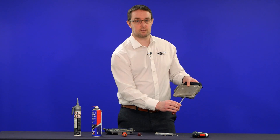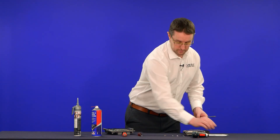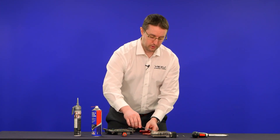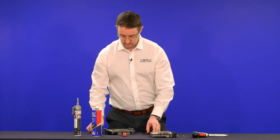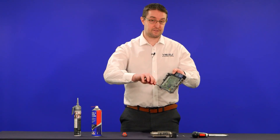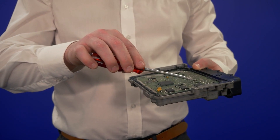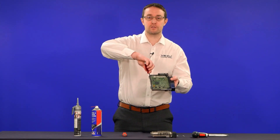It's also important we get the correct angle. We do not want to put our screwdrivers in and lift in the wrong direction — that puts all the pressure on the edge of the ECU and we're actually levering against the circuit board. If I apply that method on the open ECU example, I'm actually pushing on the circuit board trying to lift the lid. If something goes wrong you risk sliding across the ECU. When we're in there those few millimetres, we want to lift up and away — pushing against the edge of the ECU itself, not lifting up onto the circuit board.